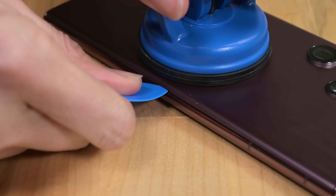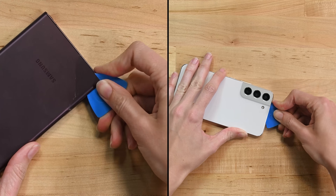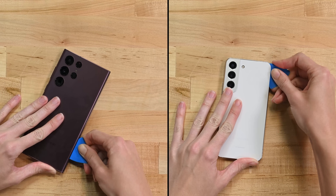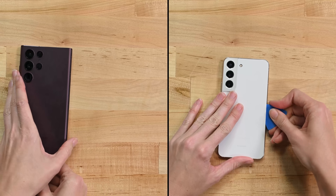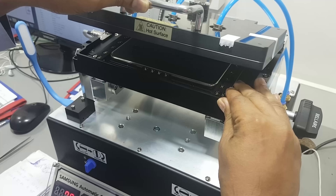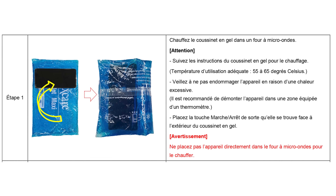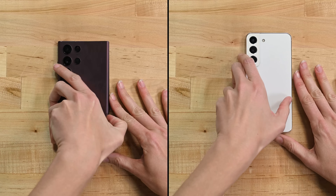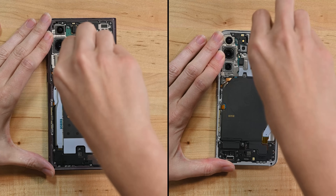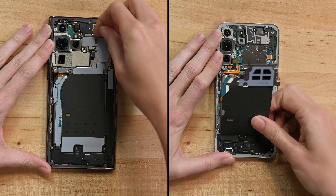With a lot of heat, a suction handle, and some adhesive slicing — oops. The noble plastic back experiment of the S21 seems to have failed; Samsung is still using fragile glass backs. Thanks to some impressive camera bumps, our mat isn't able to evenly distribute heat. Samsung used to use expensive jigs to get around this, but they've started recommending lower heat and simple gel packs, at least in French. The adhesive still feels pretty stubborn, but a longer repair that's actually DIY-friendly is still an improvement. We're guessing the French repairability index is forcing Samsung away from the dark side and toward repair.